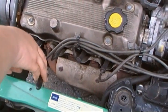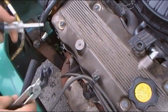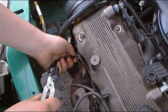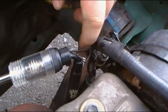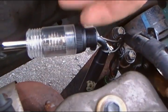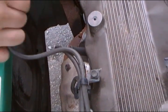I'm going to start by checking the spark. I'm going to use the spark plug pliers to take the spark plug wire off. Now I'm going to put the spark plug power tester onto the spark plug and into the wire, and then crank the engine to see if it sparks. We had no spark here, so now I'm going to check the power going to the distributor from the coil to see if that's where our problem is.